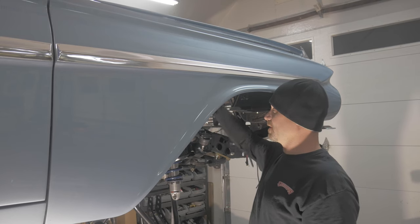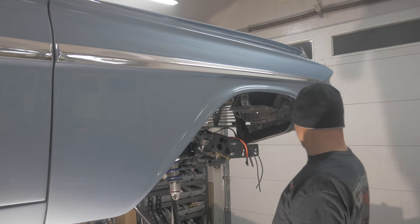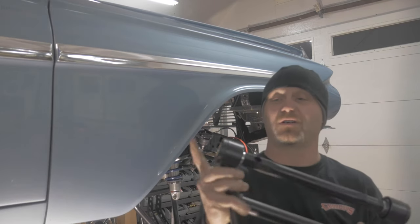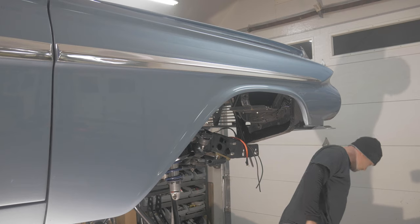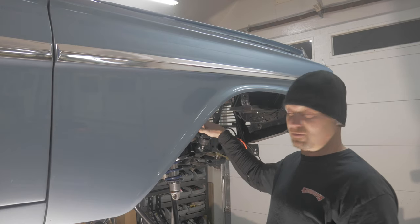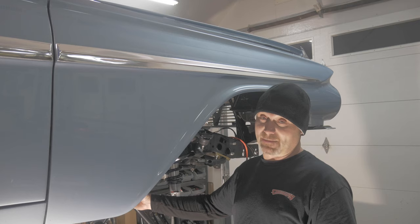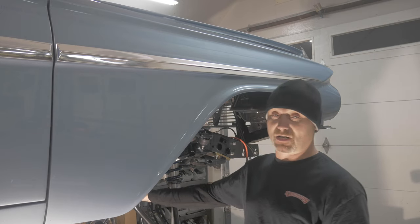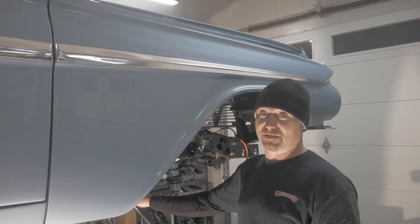They sent me another set. We go for the second install and they send you a bunch of loose hardware — so your control arm comes pre-assembled like this, and they want you to install the side caps, bolts, and everything yourself. On a four thousand five hundred dollar kit, they want you to put some of their arms together. I argued with them because once you install the hardware they're talking about, there's a humongous gap between the bushing and the washer. I called Rytec, sent them pictures, and they said they'd take the arms off, press the bushings in further, and reinstall the hardware. I said, 'Shouldn't that have been done like every other brand, even CPP?'